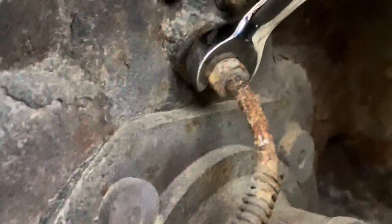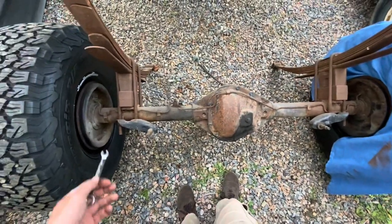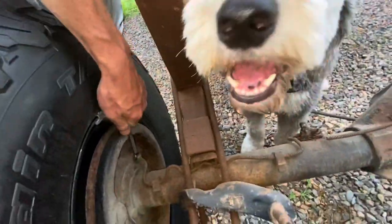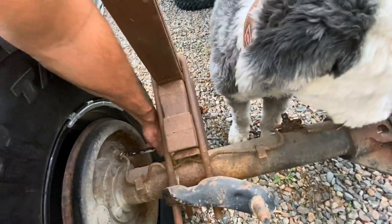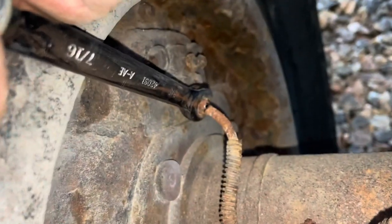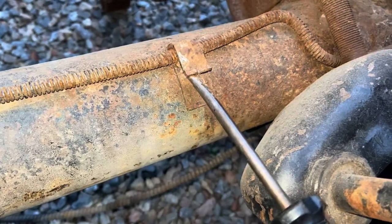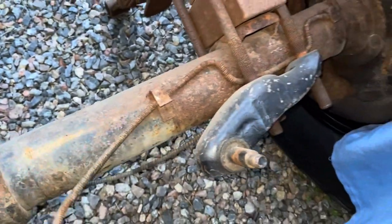And it does — see that, it's just going to wind up breaking it. So we're doing new brake lines, filling up the axle housing, then getting a quick scuff and some paint on it. To get the brake line off the axle housing, use a flat tip screwdriver on these hold-down tabs and lightly pick up. If one of the tabs snaps, it's just a piece of metal that's bent — you can always replace them.